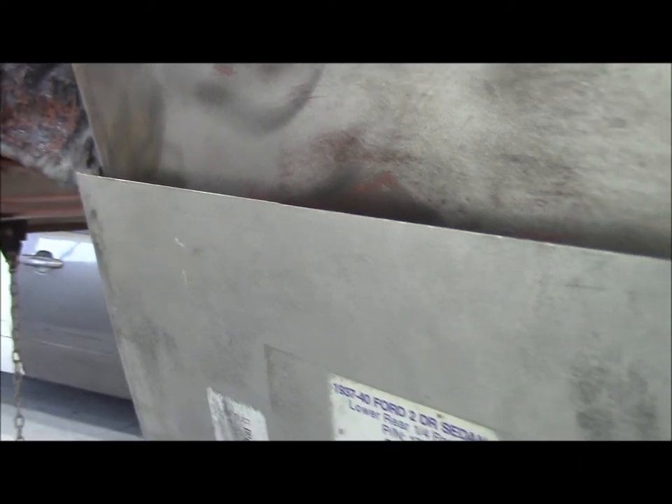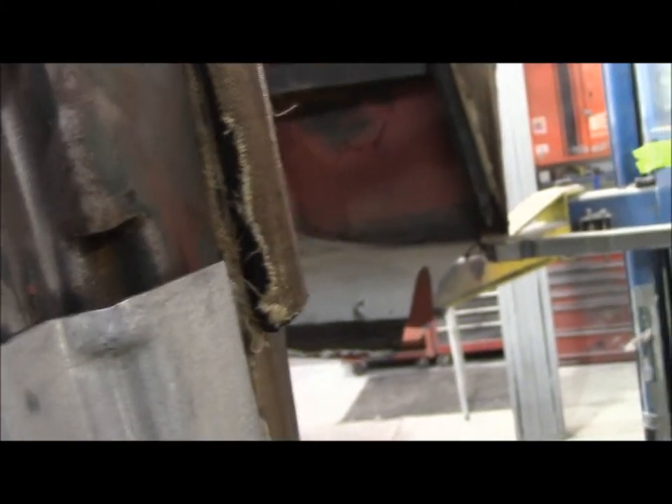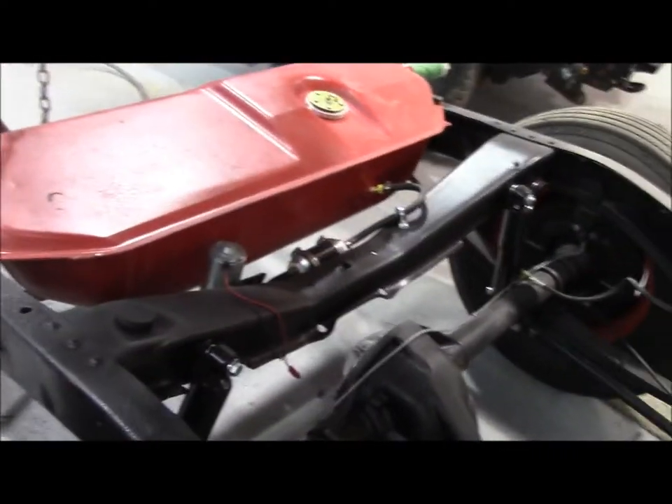Another handy way of doing this — and this works, trust me — get yourself the thinnest possible cutoff wheel you can get. Get this mounted in place where you want it. I'll do my cut down low, and then all this down here where my finger is pointing will be gone, so this panel will fit in tighter. But it's still going to be overlapping up top. Then I'll vice grip this panel on and cut with my thinnest wheel all the way across this top lip on the old panel, which will give me just enough where it will push in and I'll butt weld it. There's a little trick right there for you.